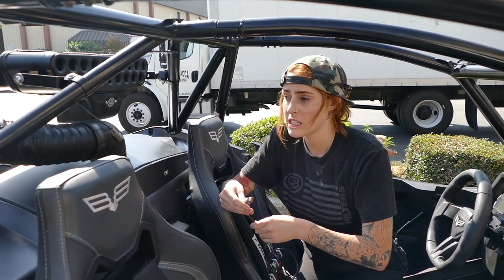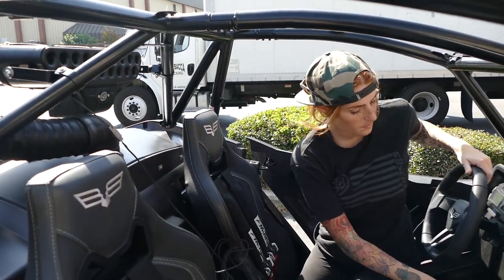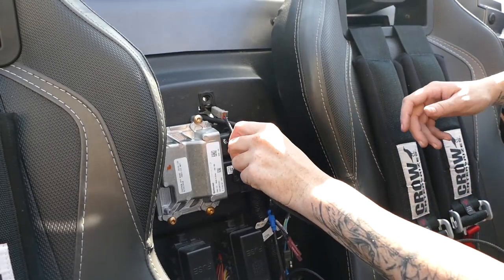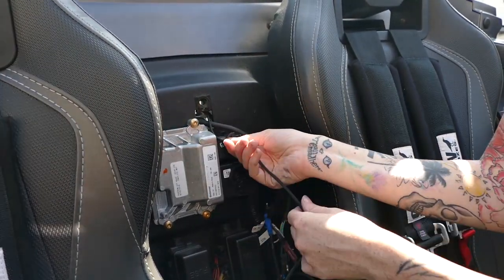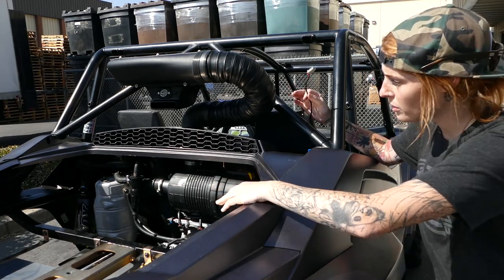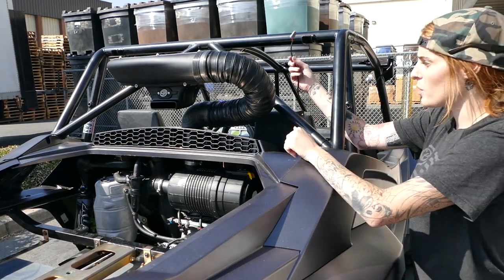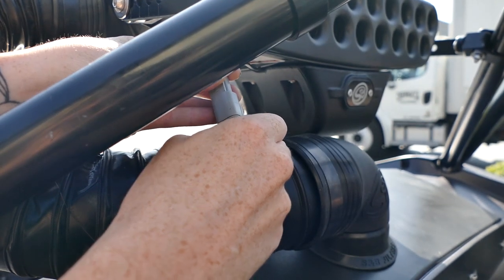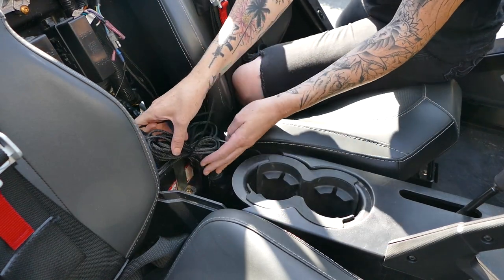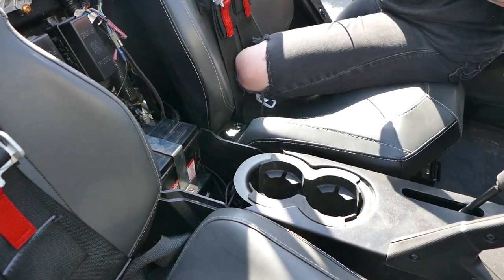Now that you've installed the wiring harness, before you make sure everything's in place, we're gonna want to make sure that the fan connection actually works. You're good to go. Now we're gonna take the fan connector and put it through that little hole — make sure you sneak it all the way through. Since it's a little hard to see, in order to get this wire over here I had to pull it from back there, route it through here, and then up through this hole, and then we'll be able to connect it. Once the wiring harness is in place you're gonna want to tidy it up a little bit using the provided zip ties, and then just put it down in this little pocket before you reinstall the cover.